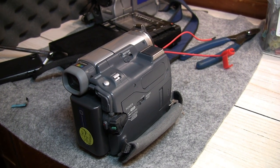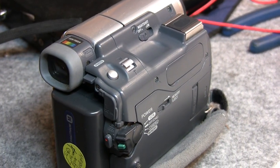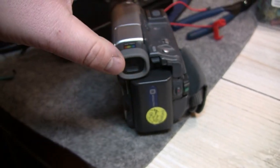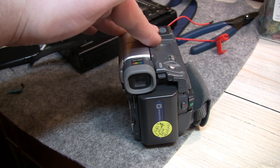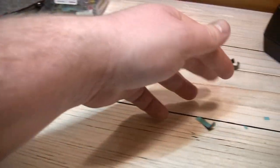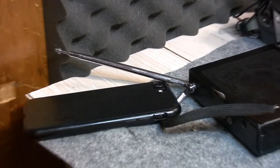Okay, first official recording test on the Canon Vixia HV40 HDV camcorder. Here's what I was using to record the beginning of this video with. With an Infolithium battery that at first was throwing an Infolithium error, wasn't turning on. Rather, the camera would turn on, but then it would complain that it wasn't an Infolithium battery and immediately turn off. And it just started working fine, so I don't know what was going on with that. But I've got tape shrapnel just about everywhere, and splicing tape and pieces of the hand strap everywhere. But seems like this is recording fine now.